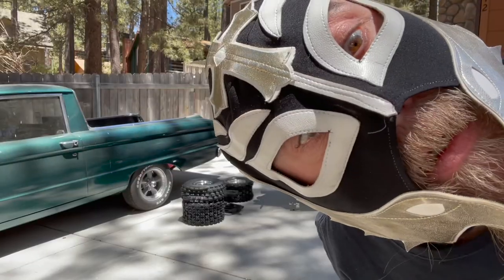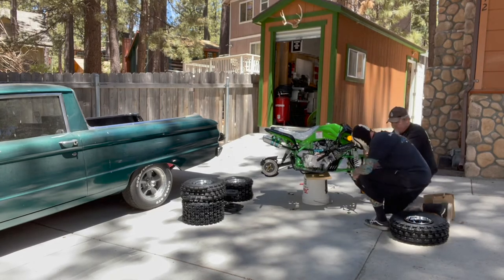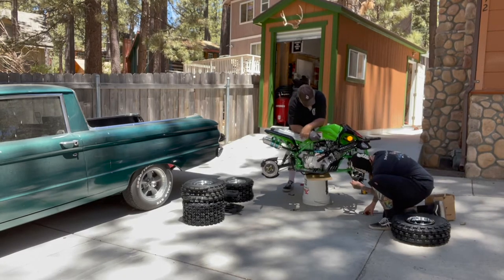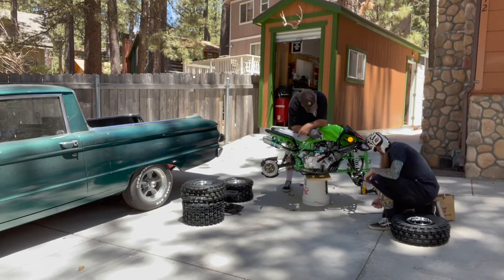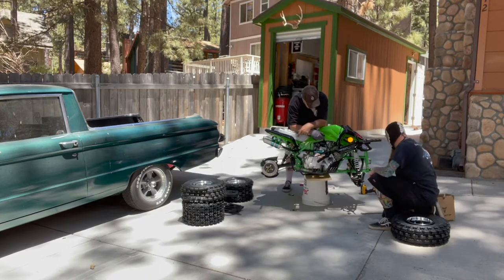Okay, people, so once we've got our castle nut tight, we can then take our Mr. Cotter pin, gently stick it in the hole, and bend it around so it doesn't get your ankles while you're riding. So, voila. Now we can go on and put the wheels on.